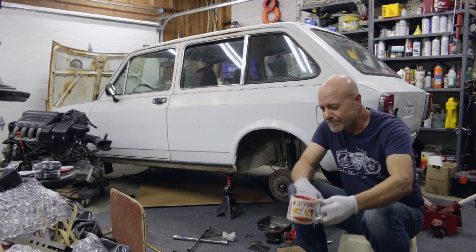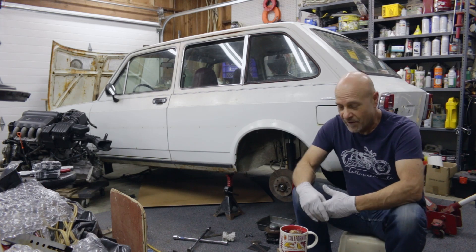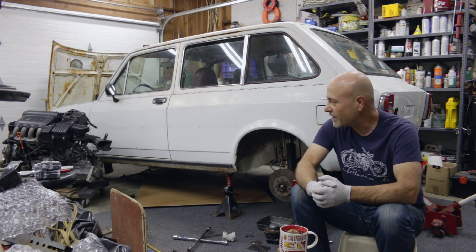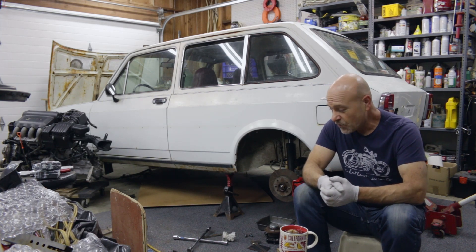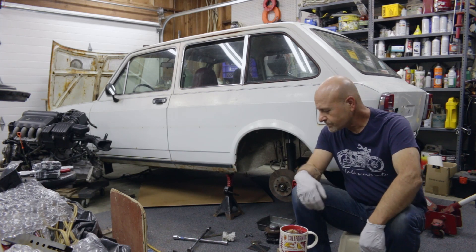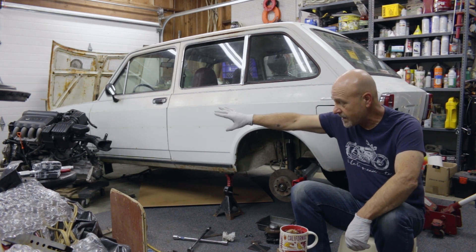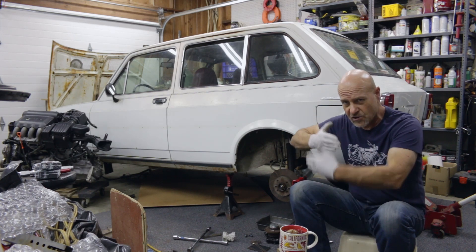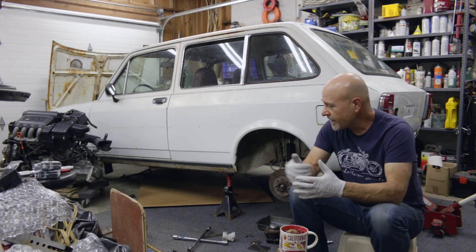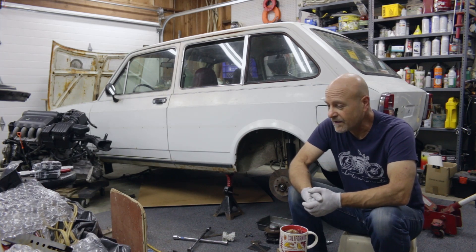The little one is in the garage with the other little one. My wife's car is outside — she's being very nice letting me put this in here. She was out of town for about a week. Before that I was out of town, and I had finished up doing the work on the Honda engine — it had a cracked timing chain case cover, which was also structurally part of the engine mount, so I replaced that.